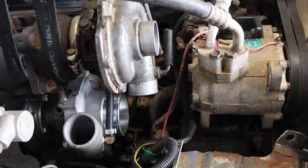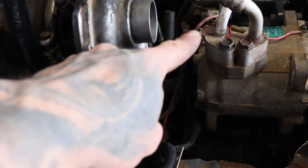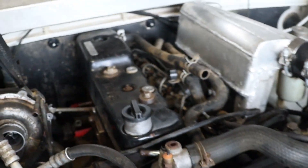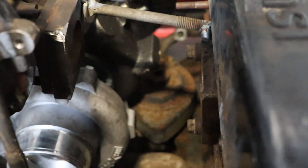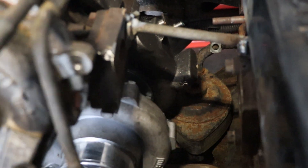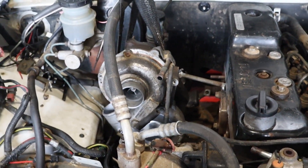You can see in there — there's also a brake line there, the air con which had to go. Turbos had to go back far enough so I could run a pipe out here to that turbo. The air goes from that turbo to this one. And then there's also the oil cooler down in there, which had to miss that turbo housing, which it does. So it took a while to get the position in, but I think we've got it.